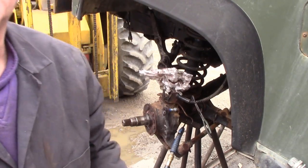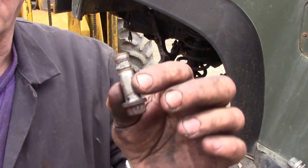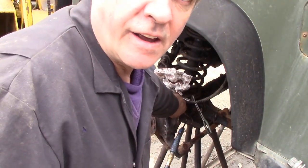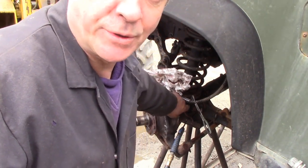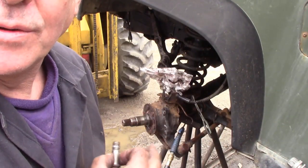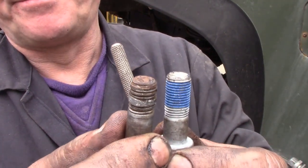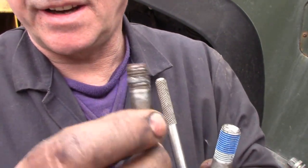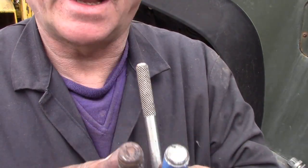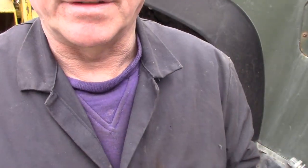Houston, we have a problem. When I took the bolts out of the caliper, somebody had fitted a coarse threaded bolt instead of a fine threaded bolt. I put this axle on straight off a Discovery because this was a V8 before, with the earlier type CVs. You can see what's happened — it's stripped out, and it's only on the early ones that had the coarse threads, like the early 80s. So be careful when you're taking the bolts out to get the right thread, because the heads look exactly the same but the threads are different.